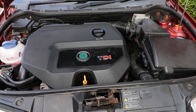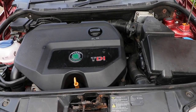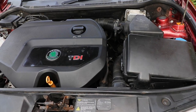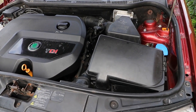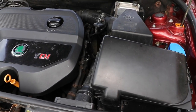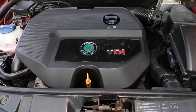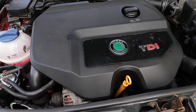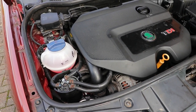The most common type of brake fluid recommended for the majority of cars is DOT4, which is compatible with but performs better than DOT3, which has a lower boiling point. Both these are glycol-based fluids that absorb water, meaning they are hygroscopic, enabling corrosion inhibitors needed to keep the inside of the system free of debris that could impede or jam the system.